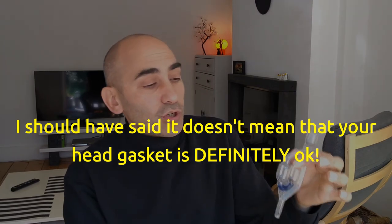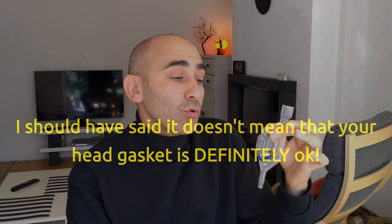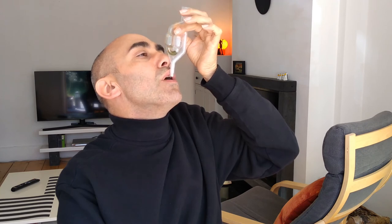So just finally, just wanted to show you this. Now, if you just want to make sure that your fluid is good, as in it's working, you can do this. As you can see, it's turned sort of greeny yellow, and that's from the CO2 from your breath, basically. And interestingly, if you use something like a turkey baster to pump normal air through there again, it would turn back blue. I tried that previously just out of curiosity. But having said that, it does say in the instructions not to recycle the fluid, to only use it once.